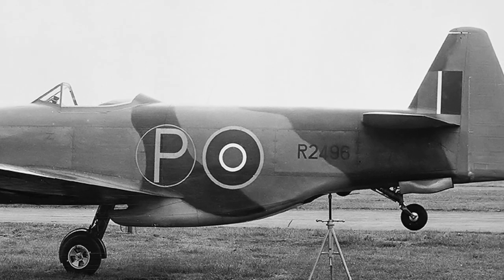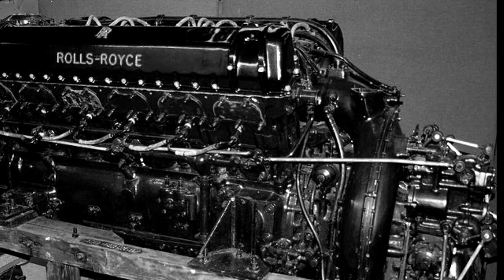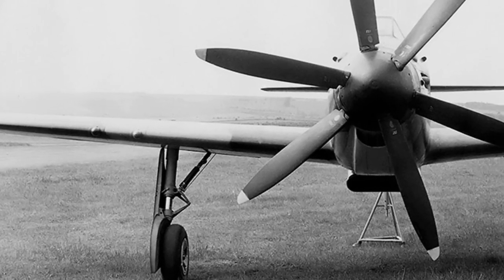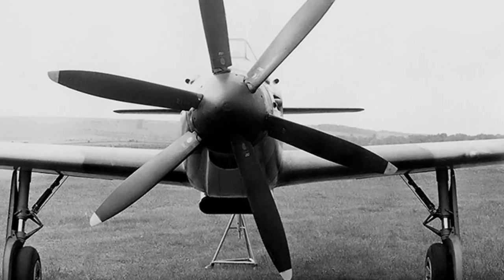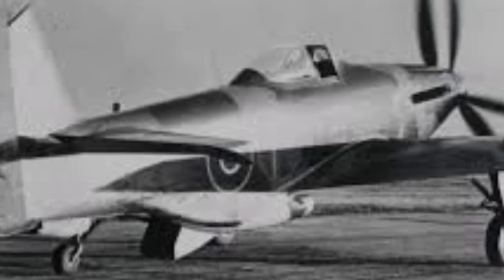the MB-5 was powered by the 2,340 horsepower Rolls-Royce Griffon 83 series engine that drove 2 3-bladed contra-rotating propellers. It took significant work by Martin Baker to convince the Air Ministry to grant them usage of the Griffon engine. Like the MB-3 before it, the MB-5 was built to specification F-1839, and while it was scheduled to fly in 1943, delays were encountered as Martin continued to alter and perfect the design.